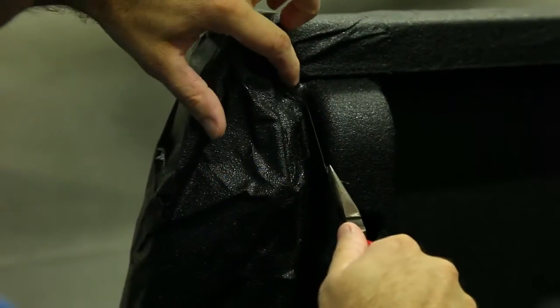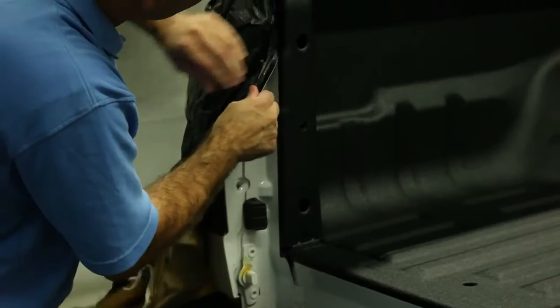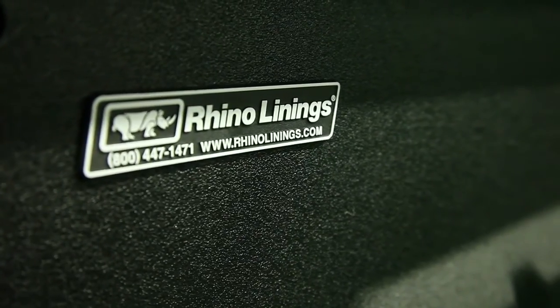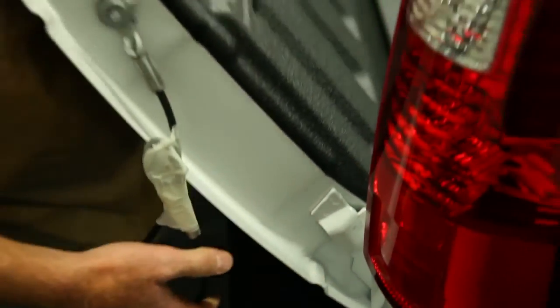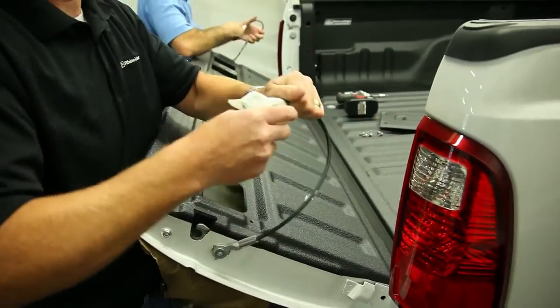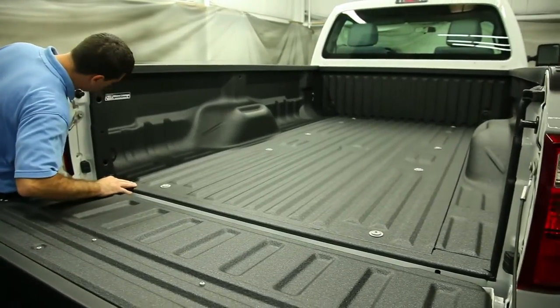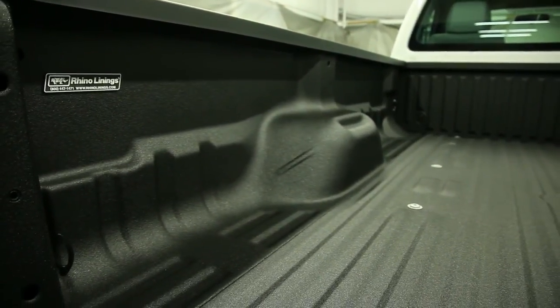You are now ready to unmask the vehicle. Start by pulling your wire tape lines around the entire truck bed, then remove all the masking paper and masking tape from the rails and tailgate. Apply the Rhino Linings nameplate to the sidewall of the truck bed to ensure you have installed an authentic Rhino Linings bed liner. Reinstall the tie downs and hardware into the truck, then install the tailgate — remember to re-hook the cables. Replace the access cover and secure it with the screws. You have just completed the Rhino Linings truck bed liner application. For more information about joining the number one brand in the industry, please visit RhinoLinings.com or call 1-800-422-2603.